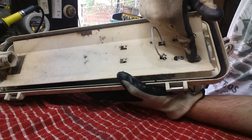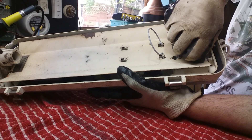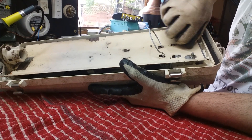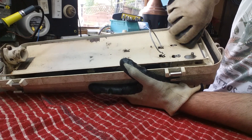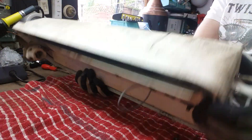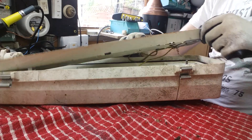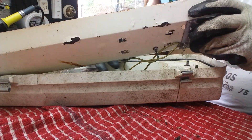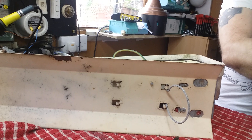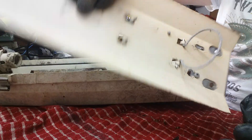Anyway, these are quite easy to dismantle. These two through-bolts here just unscrew like this and then the tray comes away. It might be a bit difficult getting the tray away on this one because I'm going to guess there's going to be an earth connection — or CPC as we say in the professional world. Just get the little washers off and it should lift out. There we go — and as I guessed, it is. So it's going to be totally fine to snip the earth on this so we can get the tray out and have a better look inside. It'll be rewired anyway.